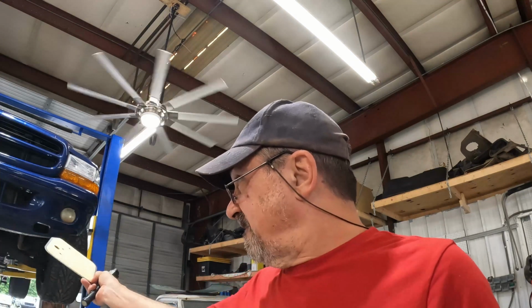So next up, let me get the valve body out. And one other thing I'm going to check while the valve body's out, it's got to come out because I need to change the shift shaft seal, but I can also access the solenoid for the torque converter lockup, and I'll hook my scan tool up and see if we can make that solenoid operate while it's sitting out and see if the solenoid's bad.